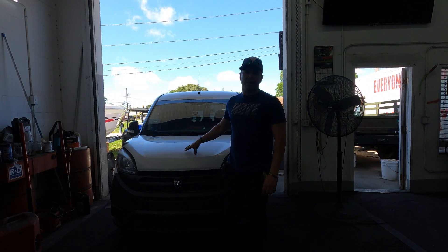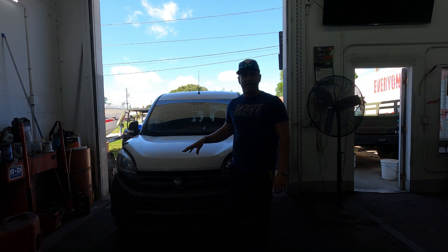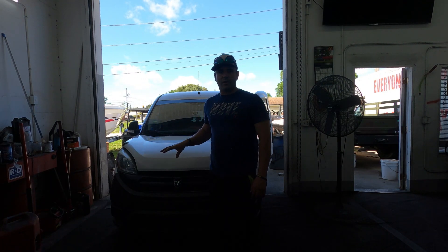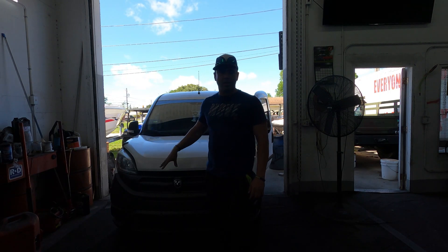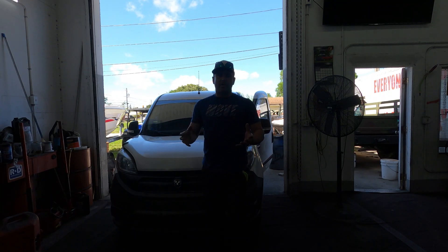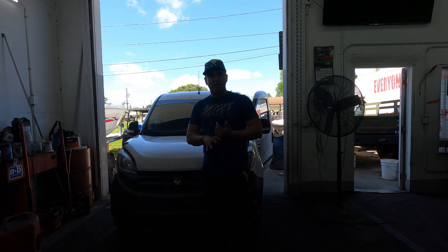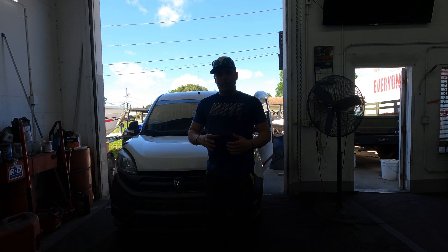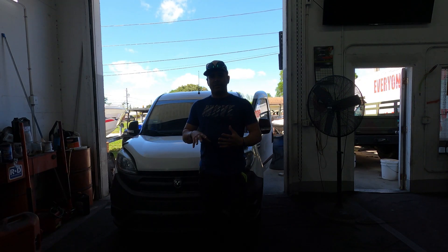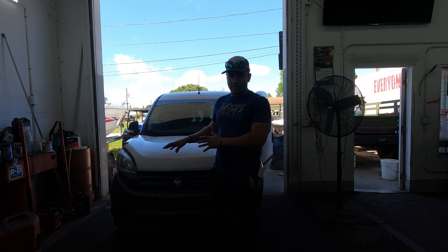This is a car from a very good friend of mine. He called me a couple days ago and told me: a friend of his had replaced a fan on the car because it wasn't working. He installed a brand new fan and now the car is overheating every time they drive around the block — the gauge goes all the way up and coolant is coming out of the reservoir. He noticed when he turned the car on, he doesn't feel the fan kicking in, like the fan is working. So he believes there's something wrong. I drove it already and I didn't hear the fan working at any point.